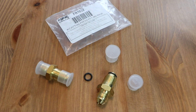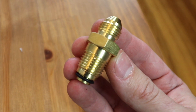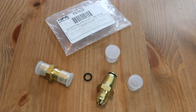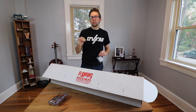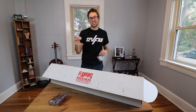To hook one of these rack and pinions up, you're actually going to need their fitting kit. At first glance, they are the same threads as pretty much every Fox Body slash Mustang rack and pinion out there — M14, M16, 1.5, yadda yadda yadda. The difference is the placement of the O-ring. So while they may thread into each other, be sure to get this style because it's designed to work with the way their fittings attach.